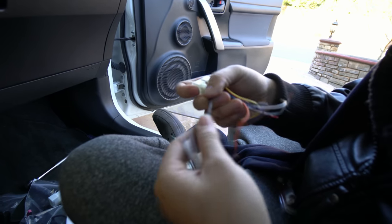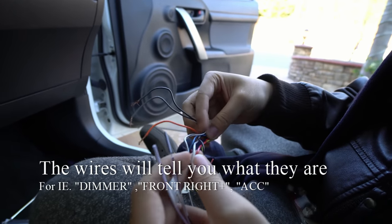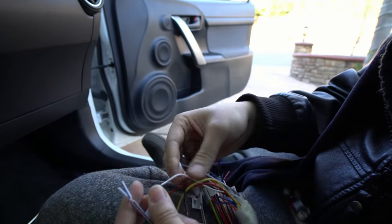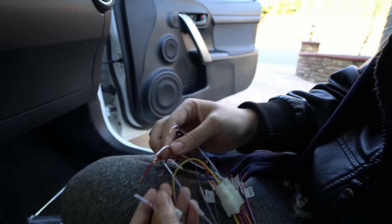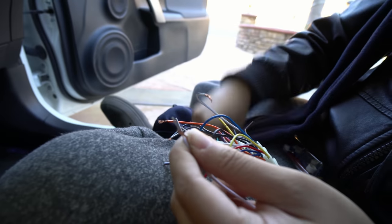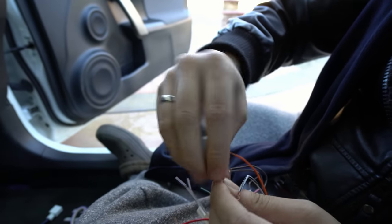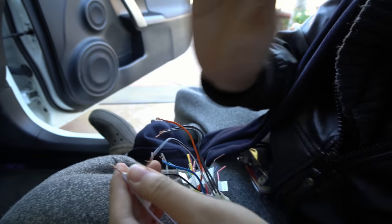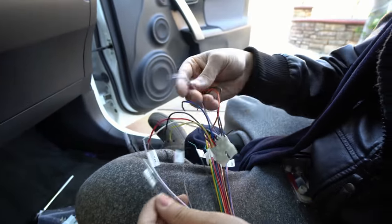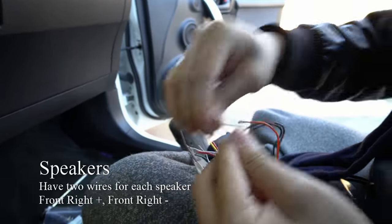Usually you can see it in the wire too, but I just know that this is going to be the front, the white one, front left. Yeah. So the white one without any stripe is the positive. All you have to do is something like this, and you can tape tie it and make it look nice later, or solder it, but honestly, this is fine. It's not professional. Okay, this is not a professional install. And then you have your front left negative. And in this case, it's even color matched. Look at that. Black, white with a black stripe. You can take out this bad boy.